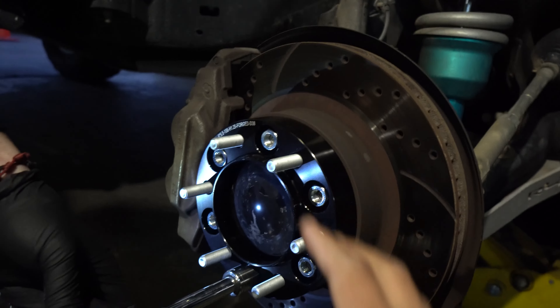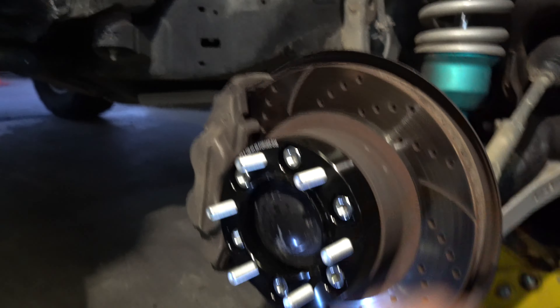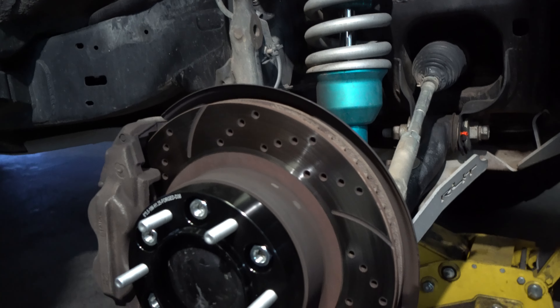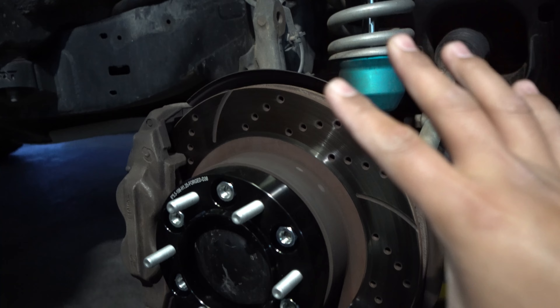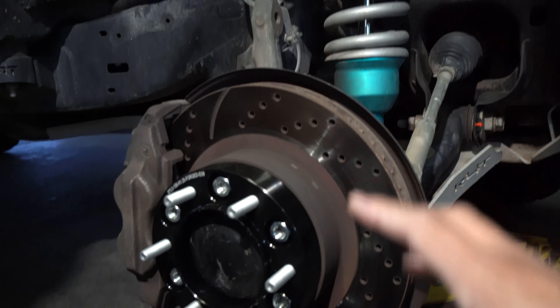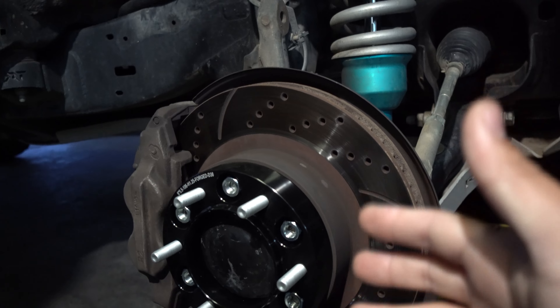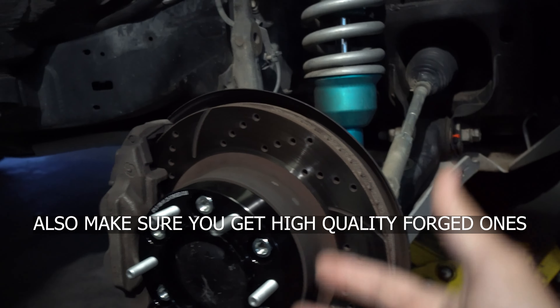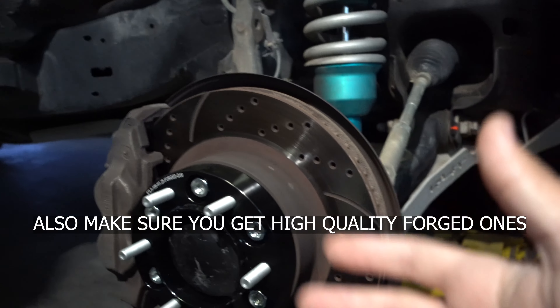Right now what Jerry's doing - one thing we want to let you guys know is when installing any type of spacer you do not want to hit it with an impact gun. It looks like Jerry was doing it but all he's really doing is just slightly tightening it a little bit inwards so we don't have to be tightening it by hand so much. Once we got it to a position we like, I'm going to go ahead and get the socket and do it by hand. We're going to tighten it down to spec and the Loctite will help keep the threads in so the nuts don't come out when I go off-road. Running wheel spacers is a little bit risky - but if you specifically need it just like me, go ahead and do it. Just make sure to choose a reputable brand; KSP Performance is what I'm installing today.